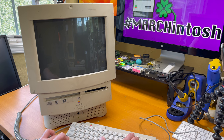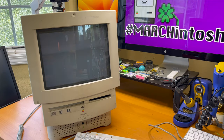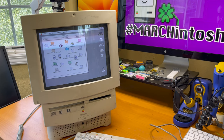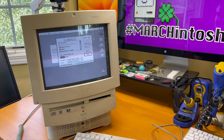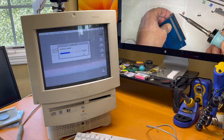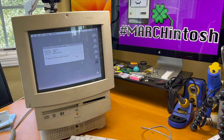It's booting! You can hear the hard drive spinning up. I'm trying to boot off the external SCSI SD. There's video — okay, it's booting off the internal drive. Sincere apologies about the flickering. We're going to boot off the external SCSI SD and back up the internal drive. We'll use Disk Copy to back up — create image from disk, select the built-in hard drive, put it on our backup drive, read only and go. Looks like it's an 80 megabyte hard drive. The disk successfully imaged and is now backed up.